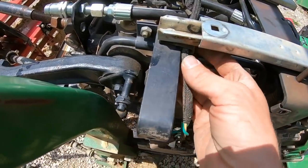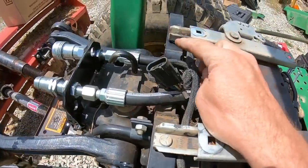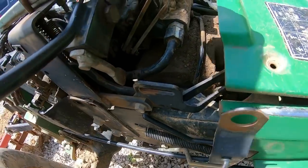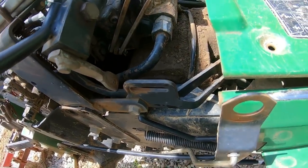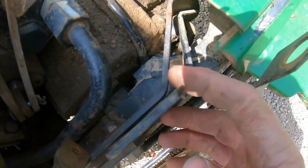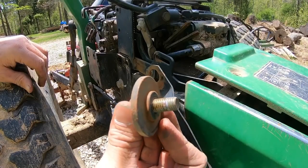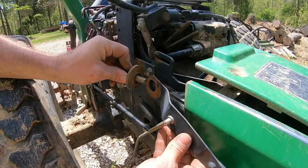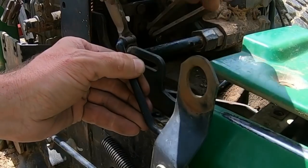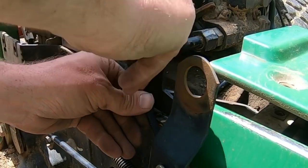This back on. Biggest thing to remember on that, which I forgot and then redid, is there's a little clip right there that holds these wires on both sides. Put that one in pretty easy. Flip those up out of the way from the SCV. And we've got to get these linkages to sit right down here. And then the bolt that holds that just looks way different than everything else because it's got this big fat washer that rides right there on that linkage. That's going to go in there when we get to that point, like that.